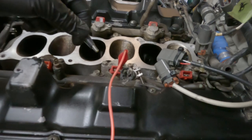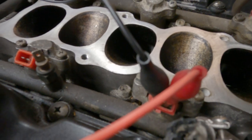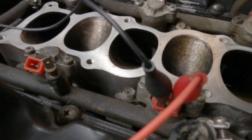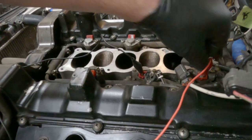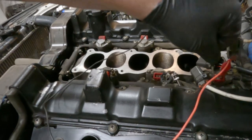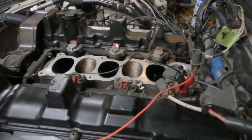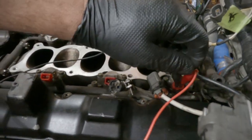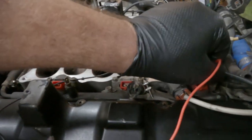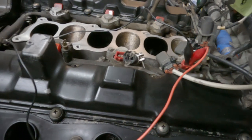We'll see if this thing makes any noise. I'm almost positive if it's capable of working, it's gonna work with these alligator clips. That injector is functional, which makes me wonder if the smartest thing isn't just to put them back in rather than swapping them out. That one's dead — nothing. That injector is doing absolutely nothing. I'm gonna wiggle these wires and see if maybe the connection's just totally that bad. Nah, that thing's dead.